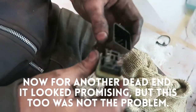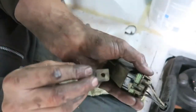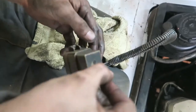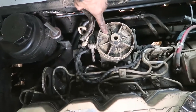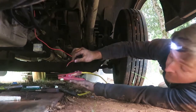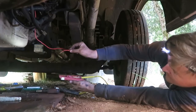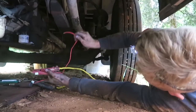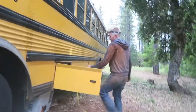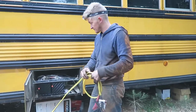As I'm troubleshooting and going through the wires, I found this — it's the relay, and as you can see it got all corroded. This thing looks like it's supposed to be mounted on a wall somewhere, housed properly, but where I found it was just twirled up underneath the fuel housing cylinder. For anyone who still thinks it's the starter: I've got this one hooked up and the starter will turn over. That was just to confirm the starter is not the problem.